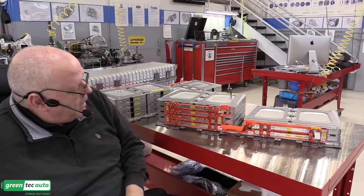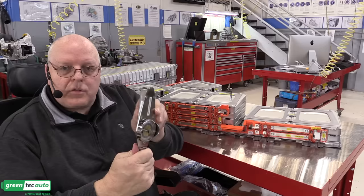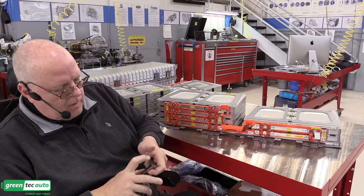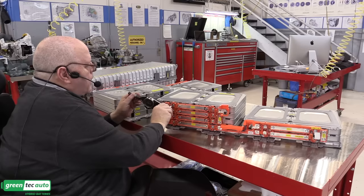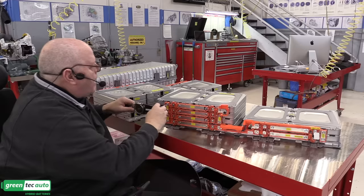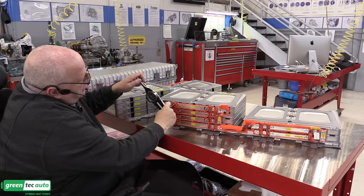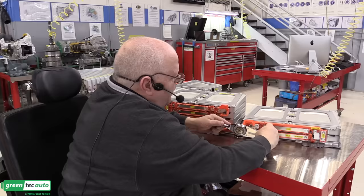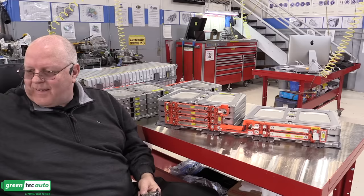Let's see, it was 49 on the bolts and 11 on the screws. All right, this torque wrench right here goes from 0 to 30 inch-pounds. So we'll do the screws first at the 11 inch-pounds. I may have exceeded that just putting them in with a screwdriver. Let's find out. I think I've got the wrong tip. All right, let's try those screws again. Number one, Phillips. 11. So it was a little more than my screwdriver did, but I just put them in real light. Okay, all the screws are tightened to the monstrous 11 inch-pounds,